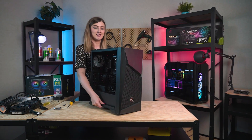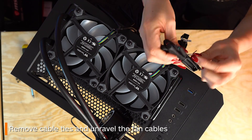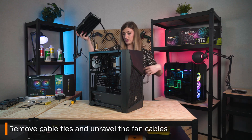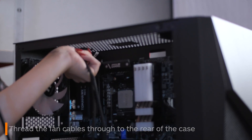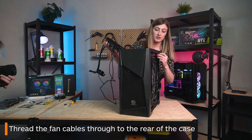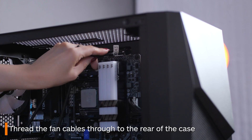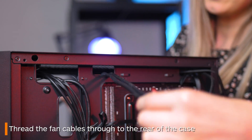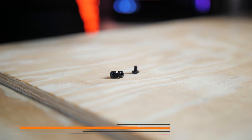So now it's time for the actual installation. If you haven't already, release all the many wires from their cable ties. Figure out exactly where you want your radiator to eventually sit, as well as thinking about what the easiest path would be for your wires to travel out to the back of your case. Thread all your wires through and then basically follow the wires to move your radiator up to where you mount it. Now using the smaller screws, screw it in.